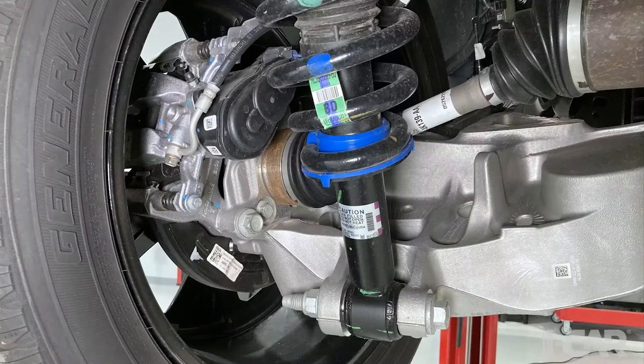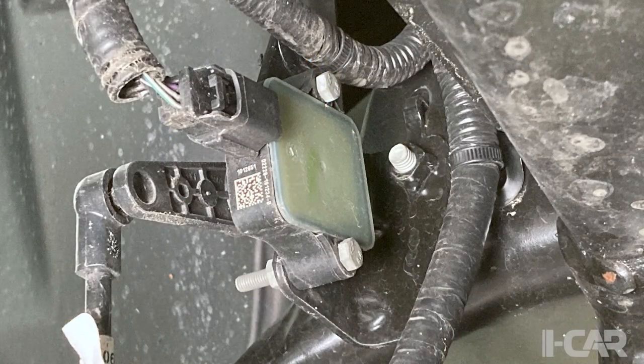Now we can go ahead and roll 32, where we'll take a closer look at the control arm. And of course, with an electrified rear drive motor setup, we've got the half shafts for the CV axles coming out, which is pretty typical for this type of setup. And this should transition to another shot where we've got a ride height sensor. This vehicle did have, and I'm remiss because I don't remember the terminology, the load sensing feature. Onboard scales. Yeah, the onboard scales, that's it. Thank you very much. As you load the truck, you can enable that feature and it'll show a bar graph in the rear taillights for how much load's in the truck. It's a pretty cool feature. In the main screen, you can see approximately how much load you have in the bed, stuff like that. And depending on the trim level, the taillights will also show a bar graph, which is pretty cool. And it's all done off those ride height sensors.